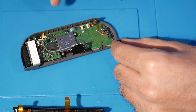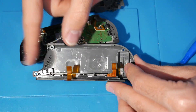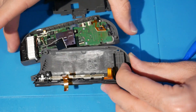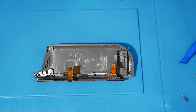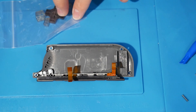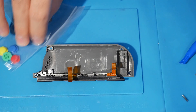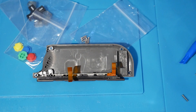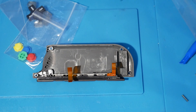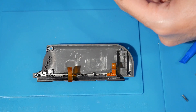I'll refer to what remains as the motherboard and we're at a good stopping point. I want to transfer what we need for the bottom plastic piece and finish that up pretty easily. Go ahead and unbox the kit. Depending on which kit you have, you might get buttons — mine has a D-pad plus SR and SL buttons, color buttons for A, B, X, and Y, and screws. I never use the screws that come with kits; I prefer to keep the Nintendo screws.